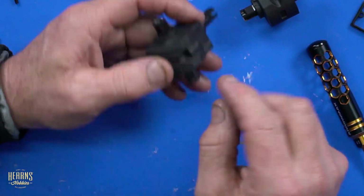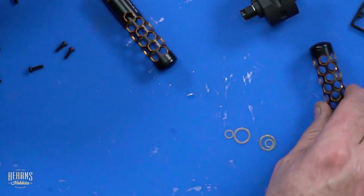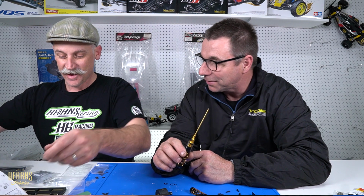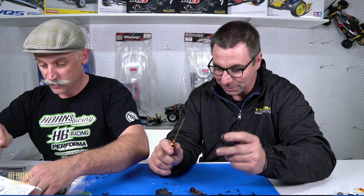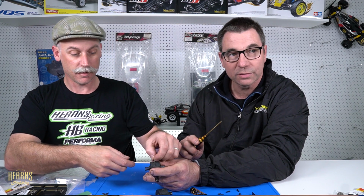Alright. So what screw do we need on the front diff at the top of the case? It's actually a special screw from memory. That is right. Is it 2.5? It is... 3 mil. 2.6 by 8, top and bottom. That's the rear diff. I said the front diff. You are hard work, Mr. Healy. We can rewind this because this is recorded. Okay, so it is in fact a 3mm by 8. So we use a tie screw on the front.